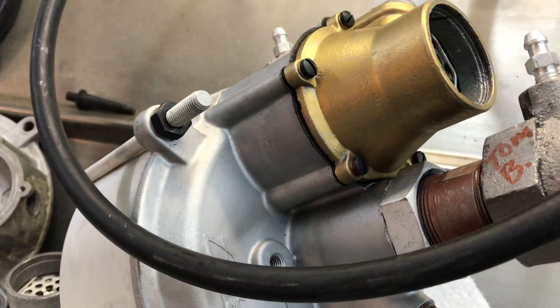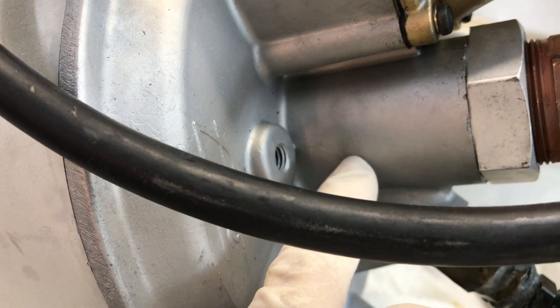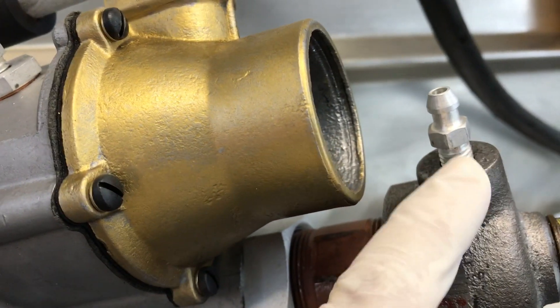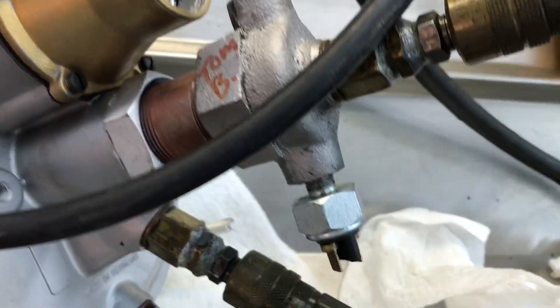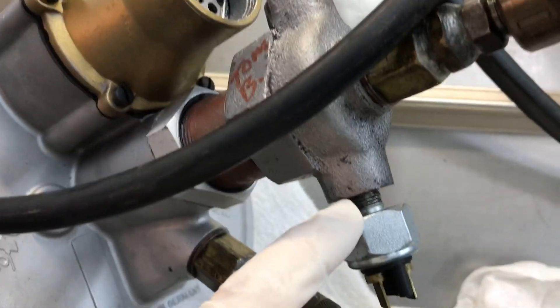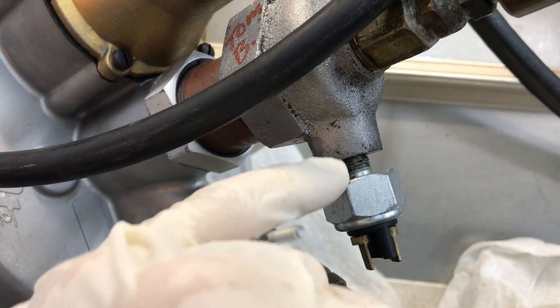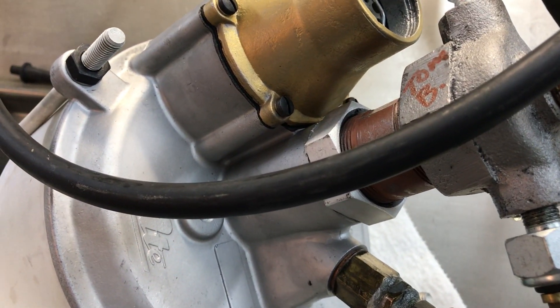We will also check for leaks around any fittings — if it's going to leak with fluid under pressure, it's going to come out underneath here. The actual sealing is down inside here, but fluid travels up the threads and comes out here. We're also checking our bleed screws. You don't need to bleed the booster out of this bleed screw — just use your top bleed screw, bleed this place first, then bleed all your wheels, then bleed this fitting last. Checking for no leaks out of here — there's a big copper seal up inside here. Obviously no leaks with our bleed screw, which I've just snugged in there. It's pipe threads, so no need to crank it all the way down.